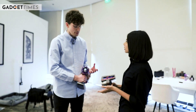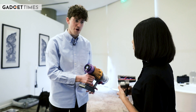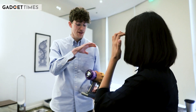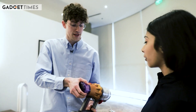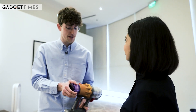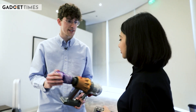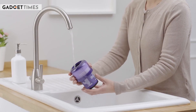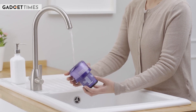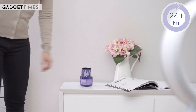You don't need to take it to a customer service center — we believe the consumer should be able to maintain the machine themselves at home. If you need to wash the filter, simply unwind it, put it under cold damp water, leave it to dry for 24 hours, and then the machine is ready to use again.